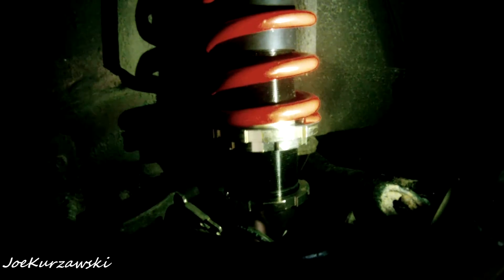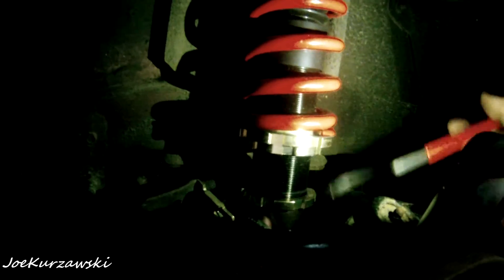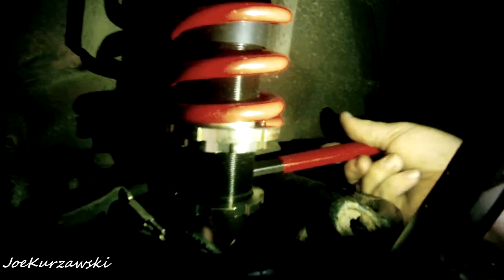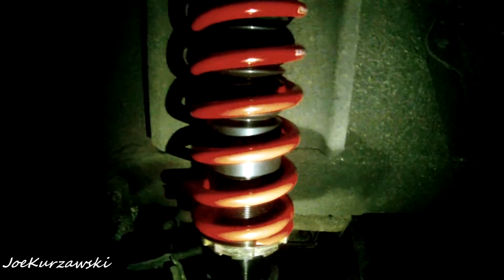You can use a tape measure or go out and get one of those little tools that you can actually measure distances a little bit more accurately. So I'm going to get to the lowering. Now that you've got it adjusted down - I adjusted mine down an inch, so there's an inch and a half between these two rings - you're going to take your one wrench here and lock this bottom collar. And that'll keep it from self-adjusting or changing the ride height. Let's put the wheel back on and do the other side.